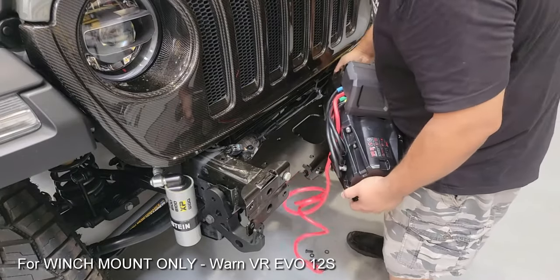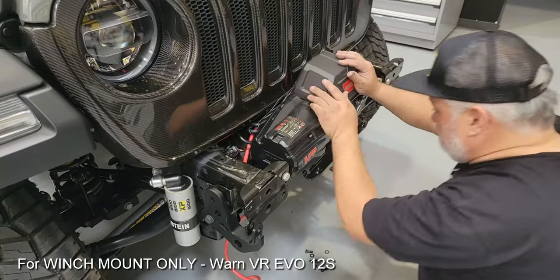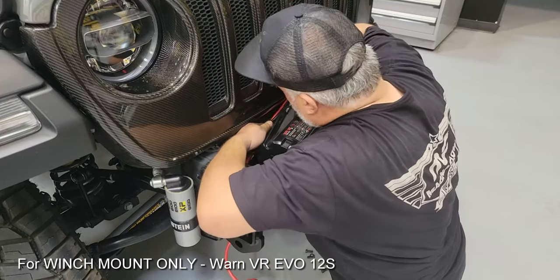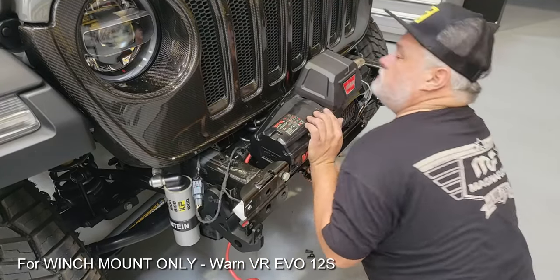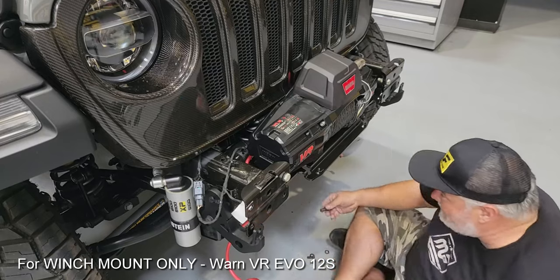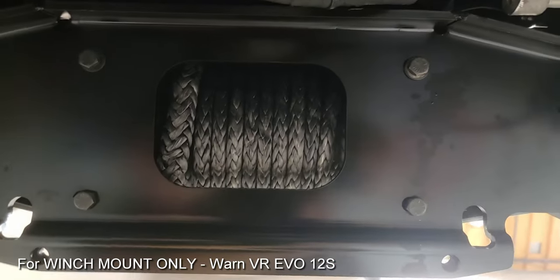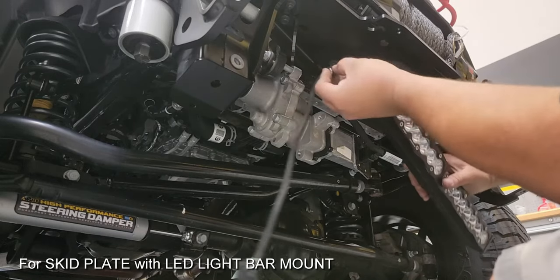I'm not going to go into too many details about the particular winch and my installation, but the things you need to pay attention to are: making sure there's adequate clearance, making sure you have good routing for your wires, and when you start putting bolts into the bottom of the winch, making sure the bolts go all the way through with enough threads, and verifying the safety component of mounting this device is correct. Here are our four bolts into the bottom of the winch plate — we're ready to move on to the next step.